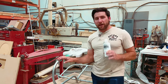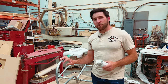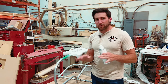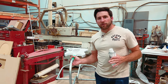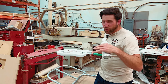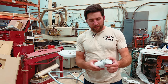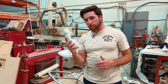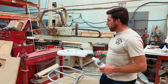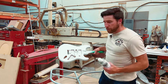I do have a specific tutorial on metallic painting. If I were doing a normal color and not a metallic, I wouldn't have gone that fine — I probably would have done 600, maybe even 400 grit. But because this is a metallic I went 800, and the reason is the metallic particles. We've got these tiny little mica particles in here that really shine and stand out. They'll pool and change the appearance if you don't have a very smooth finish, so you want something smooth otherwise you can end up with those pooling and showing lines. So that's why. I'm going to get this ice blue metallic from Oxford Supply shaken up really well.